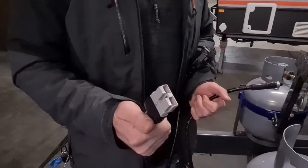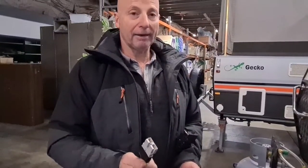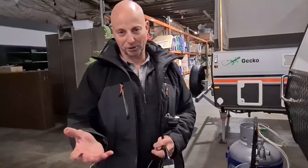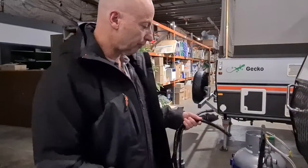Lastly, we've got our Anderson plug. The Anderson plug is used for charging the batteries while you're driving and for running the fridge while you're driving. Preferably, you have the car set up so that when the ignition's turned off, the power to the Anderson plug is turned off as well, so your battery doesn't go flat whilst you're going for lunch or stopping to look at some beautiful scenery. If you can, get the auto electrician to set it up so that when you turn off the car's ignition, power to the Anderson plug is turned off.